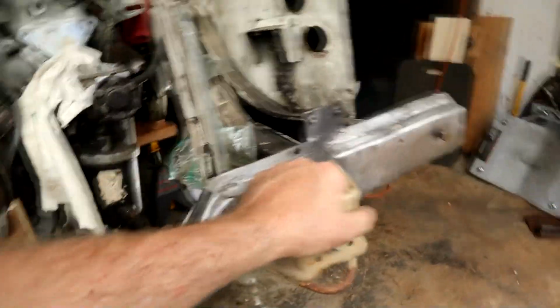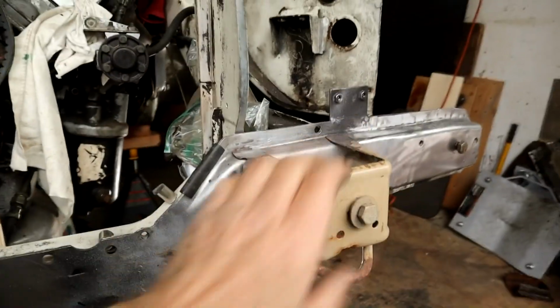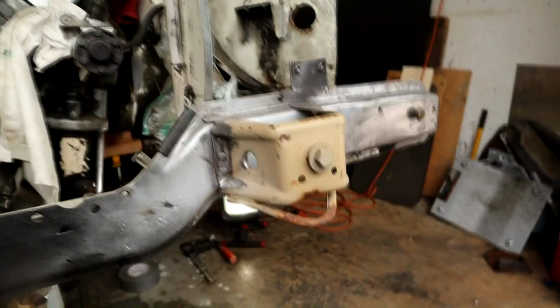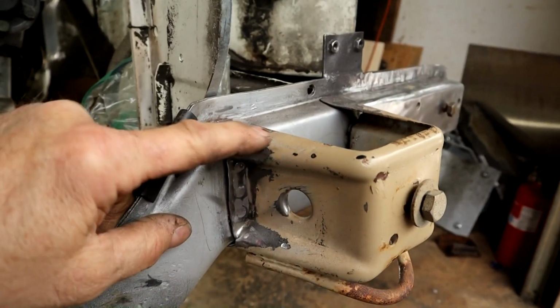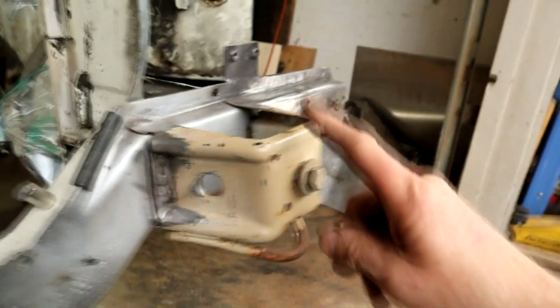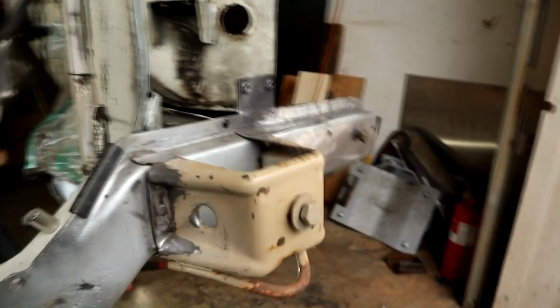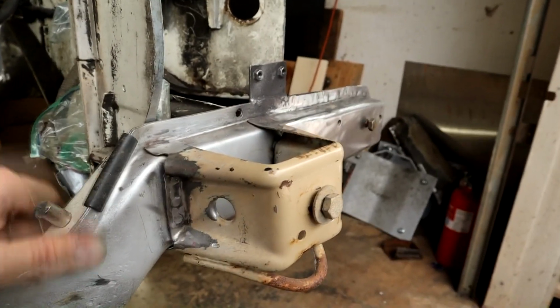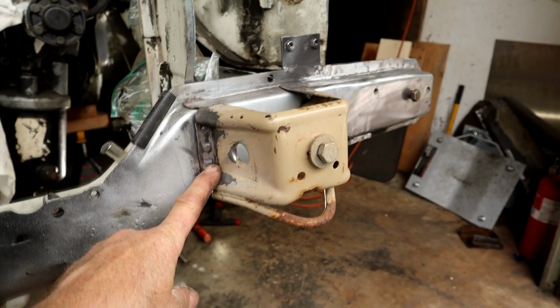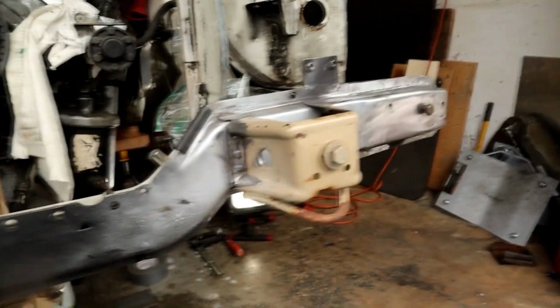So that's that. I also took this one. Now this is a bumper bracket from the donor car, and what I notice, see here on again, I'll see if I've got the original around here somewhere. I try and save the part so you can see, but you see this piece here, it had concertinaed, and so what I think's happened, someone had hit it, not really hard enough to do a lot of damage, but it had concertinaed this here, and so this bumper bracket was pointing way up, and there's no way I'm going to be able to re-bend that down. It was just too strong of a bracket. So I drilled out the spot welds and re-welded this one on and checked my positioning. I'll show you how I did that. Hold on a second.